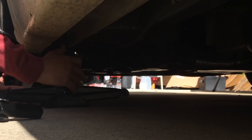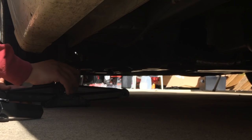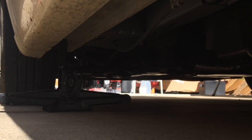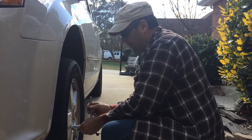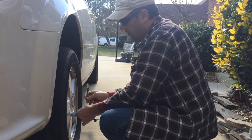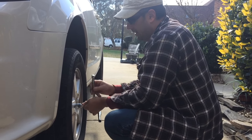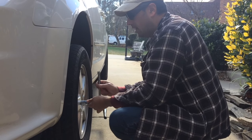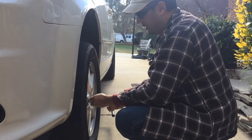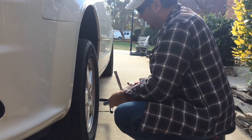This is the jack — it's got a little cleat that's going to go right up into the frame, just behind the tire. We're going to raise it up using the jack that comes with the vehicle. Now the tire's jacked up off the ground, go ahead and loosen the lug nuts all the way. It's always a good idea to put the parking brake on when it's up off the ground and put a jack stand underneath the car for safety. If you don't have a jack stand, put something solid underneath so if the car falls off the jack it doesn't fall straight down.